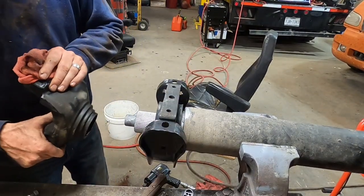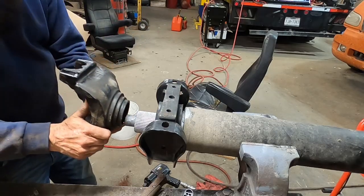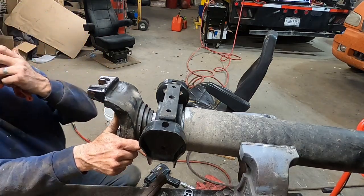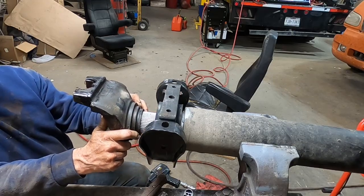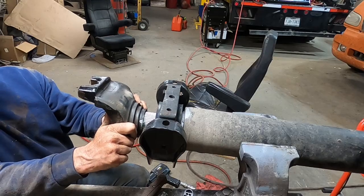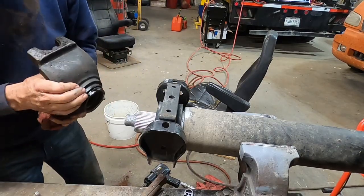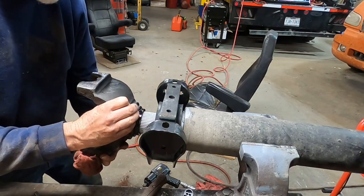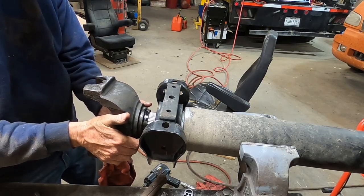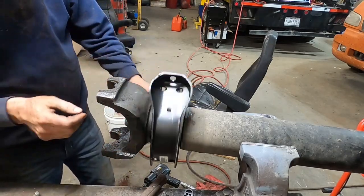All right, we got our yoke cleaned up here. Now it's this turn to go on. Remember, we got to keep splined up and keep squared up with our one on the other end down there. Like it's a one tooth off that way. Hell, one tooth each way makes it just a little bit off either way. So flip it over 180 degrees here. It's gonna do the same exact thing. Be a tooth also. We'll just put it back just like it was.